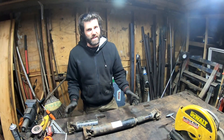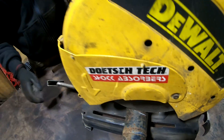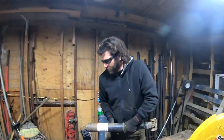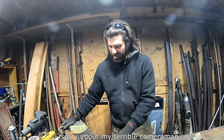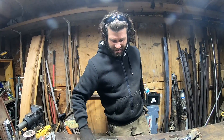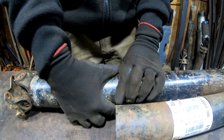Lengthening the drive shaft — same thing if you want to shorten it, by the way. We're going to cut this off right now. See where I got my line drawn there? I'm going to slide this over just a little bit because I want to add six inches, but we're going to leave a little gap here, so cut about a quarter inch short. Now for the record, if I didn't have this extra piece I would have cut that right in the middle. So if anyone's going to try this yourself, you want to cut right in the middle. When I put this together I'm only going to have to weld once. If I didn't have this, we'd have to stretch and weld it twice. This is all three-inch tubing — just happens to be the same exact size.